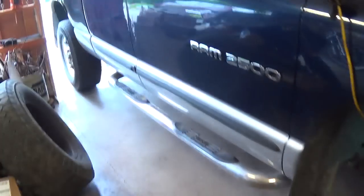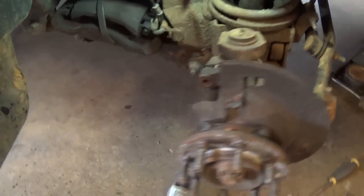Hey guys, just a real quick one today. Working on this Dodge Ram 2500, 2003 model, solid front axle. We're doing the ever-popular ball joints and u-joint replacement. The u-joint's all squealing and grinding, so that's shot. Upper ball joint's loose, so we're just doing those two things. And in the rust belt, of course, the hub never comes off right. I did a little homework before tackling this job since suspension heavy stuff like this isn't my favorite — I'd rather be poking around with the oscilloscope — but this is fun too once in a while.